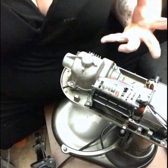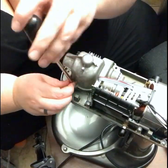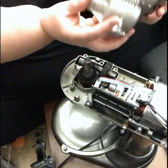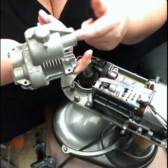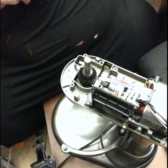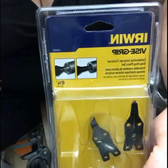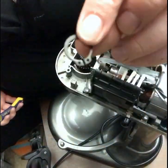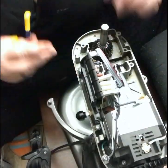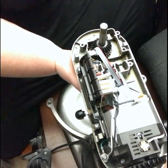The gear cover has four screws. Be mindful — there is a little circuit board right there next to it, so be careful and don't mess with that. Your gears are in there, and when you first open this to find out what gear to replace, it's going to be full of grease. You need to buy this little tool — it was about ten dollars and I'll put the link below — and it takes off this little tiny tension ring.